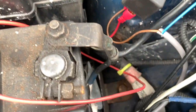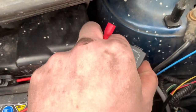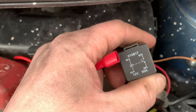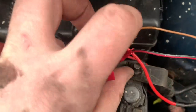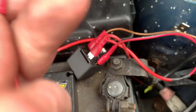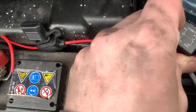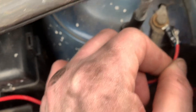Now as you can see it's routed and we've gone for a nice OEM look — it comes out here. I need to put a spare connector on it and connect it into our relay. On our relay we have the two coil pins 86 and 85. This goes into 85 — it's a relay, it's just a coil so it should work. Then this is going to be our earth which goes onto the other coil pin. I'm going to put these two wires together into one connector because the connectors are a bit big for the wiring.